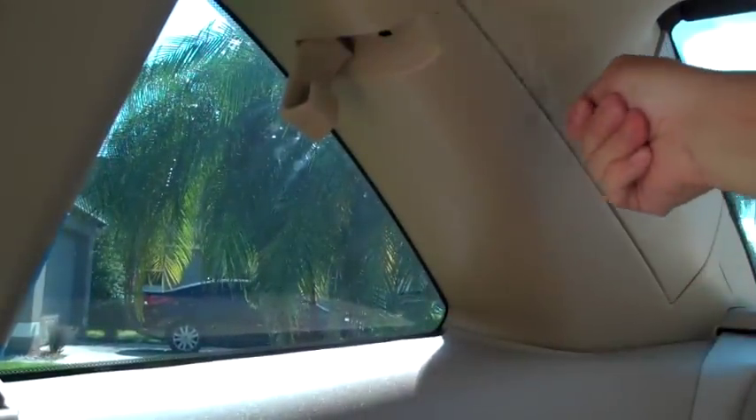Once you get this popped out, back here underneath the airbag area there'll be a little black clip you're going to have to get out. Don't know how well you can see it, but this is that fabled clip. If you have one of these trim tools, it'll make your life about a thousand times easier. Just pop that little button up there, stick this underneath, and pull it out. Try not to pull too much on this — it's just kind of a rubber piece and you don't want to disfigure it. So that is this side completely removed, just about ready to come down. I'm going to do the other side and get this headliner out of here.